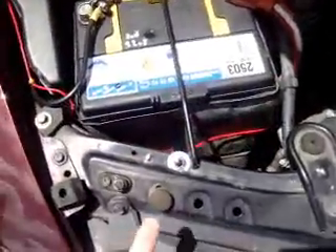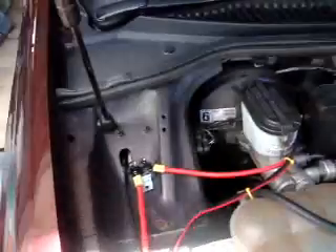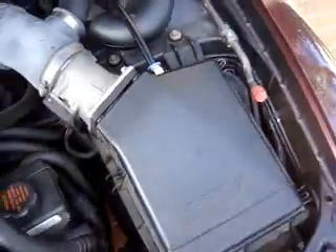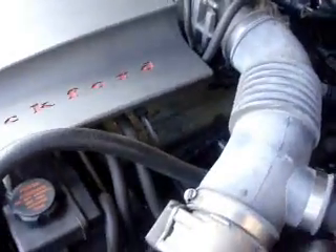This is the engine with the wiring under the battery. It's a 5 litre V8 race-tuned engine on a Ford TL50 - it's a limited edition car. This is the breaker, attached to the positive. The wiring goes all the way around to the top. The small wiring is for the fans. That black tube I'm pointing out now is the gas hosed into the air intake. We've put it before the mass airflow sensor so that when the computer reads the oxygen levels, it's there from the beginning - hopefully we don't have to use an EFIE. And there's a cold air induction for it.